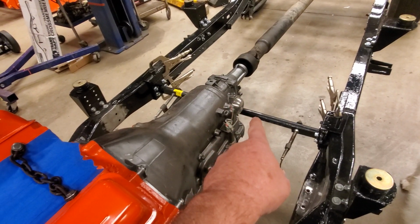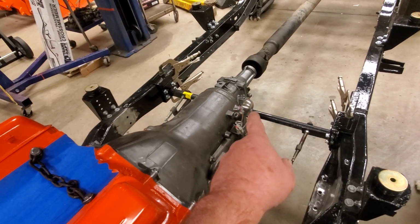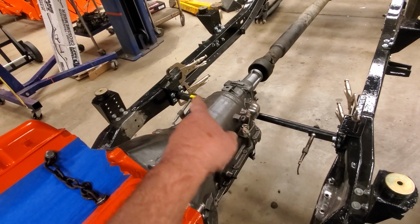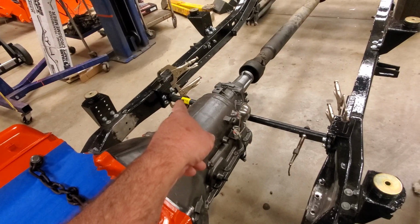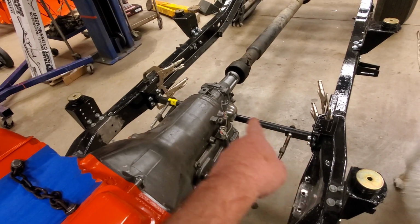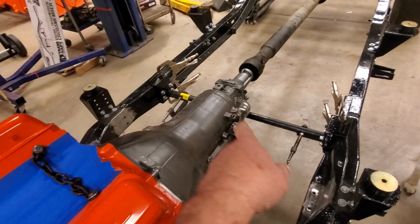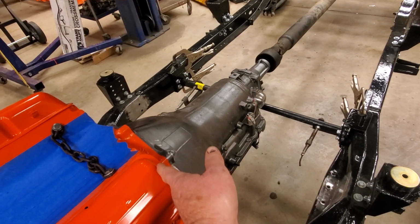And the wall thickness on this, I checked online, and this stuff will support 1,000 pounds for every foot. So if you've got a 1 foot piece in there, it'll support 1,000 pounds. I cut this 3 foot piece down to 32 inches. So it'll easily support this transmission and the back of the motor, no problem at all.